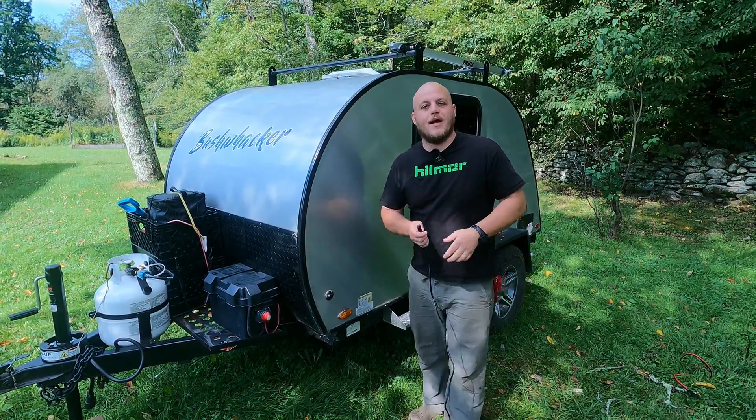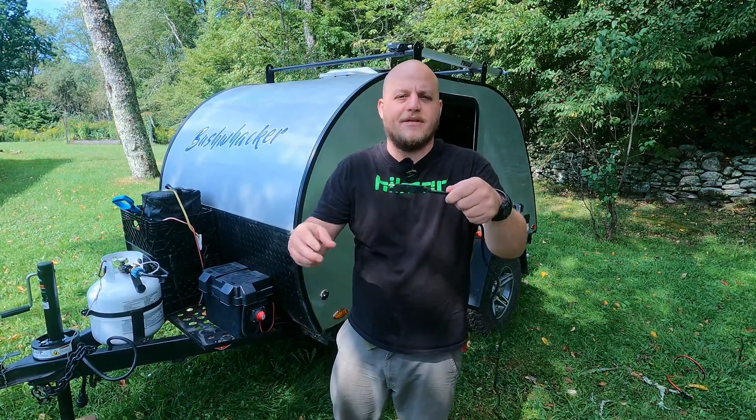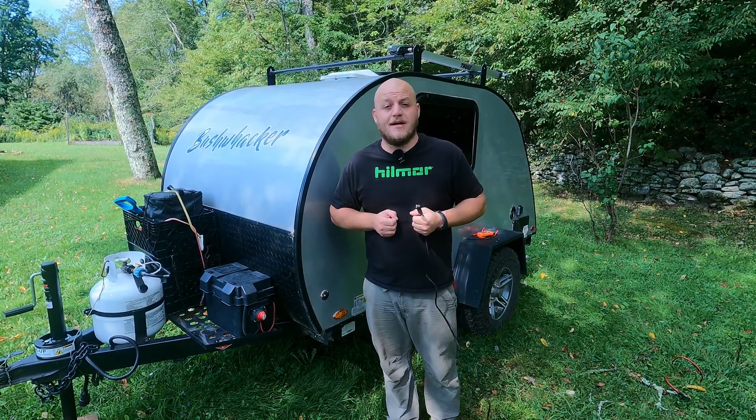When I plug these in with the adapter, my kit lines up and I can plug it directly into the camper. If this is the only way you're going to use your gear, put a little bit of tape around the adapter or use heat shrink and now you never have to touch it again. You can use any gear you want with any orientation of your solar-on-the-side port.